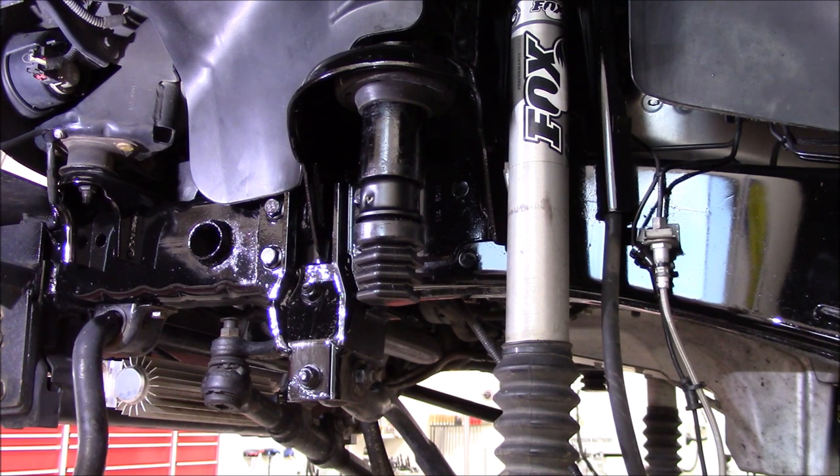Now, taking that into consideration, this is a Dynatrac Pro-Rock 44 housing. They're already 880 thousandths shallower than an OEM Dana 44 housing. So when you buy these, they actually come with a spacer just under an inch, like 900 thousandths, and that puts it back to factory. Then any bump stop you have goes above that. I had two inches of bump stop originally, so I put 3 inches total, and that's the way I've been running it, and it keeps it up out of my fender.